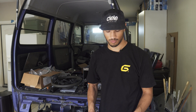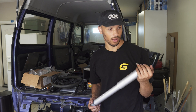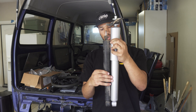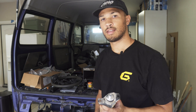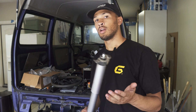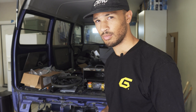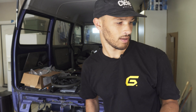Now we can get to more fun things like installing these new KYB shocks. They're a lot bigger than the OEM ones — adds probably about two inches — which will really make a big difference in the back. I reinstalled the rear shackles, ordered new OEM bushings from Honda, replaced and lubed them before putting them in. Still need to put back together the rear left brake assembly and drums, put the shocks on, and do some wiring. But this is a huge step, so very excited.